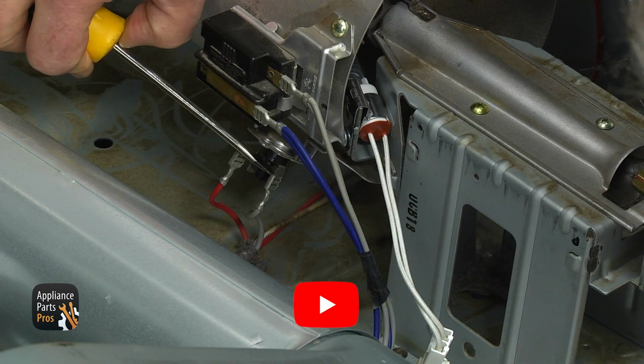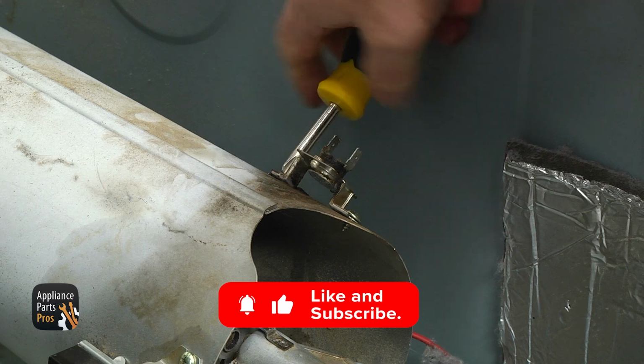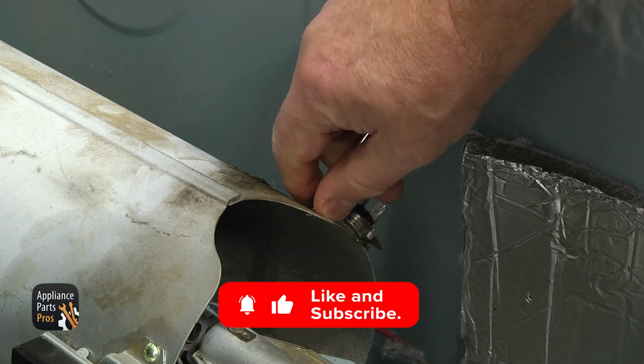As a result of our troubleshooting, we have established the guilty party. It's the high limit thermostat, and we all know it should be replaced together with a safety thermostat. Using a flatblade screwdriver, remove wires from the terminals. Unscrew 4 Phillips screws and lift the thermostats.